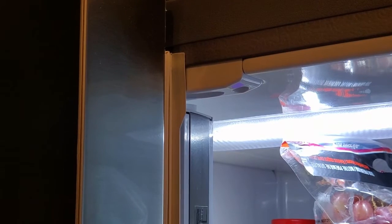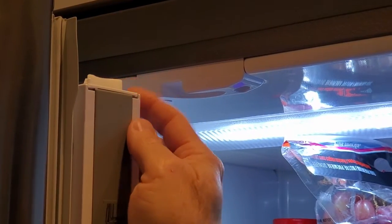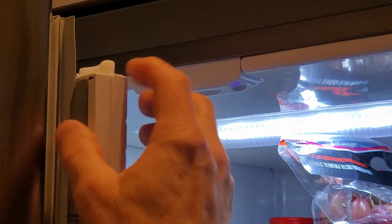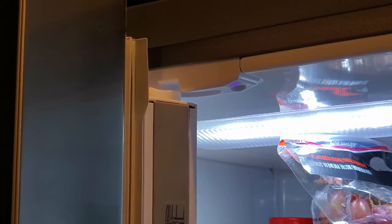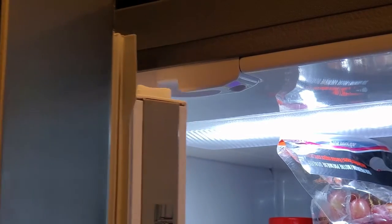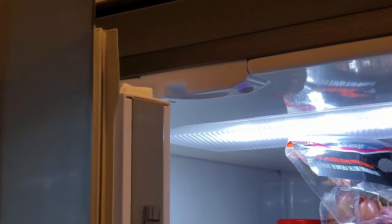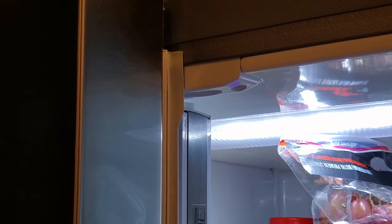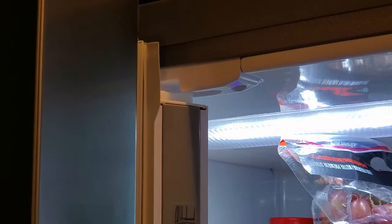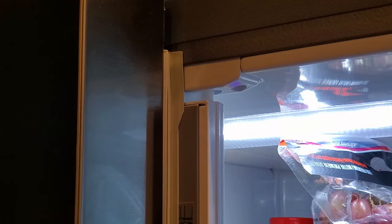My wife's making fun of me off camera. So here's the issue we're running into, a bit closer up. This top part of the door — this flap — has a little plastic tab on it which should engage in this groove and then pull itself closed just like that when you close the door. What's happening is it's not doing that because this door is too low, so what I'm going to have to do is shim this door to raise it up so it'll engage in this track and always close this little flap which seals between the two doors.